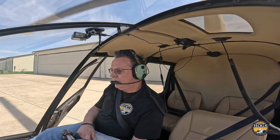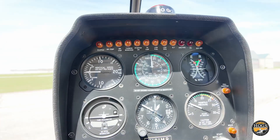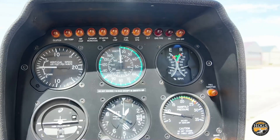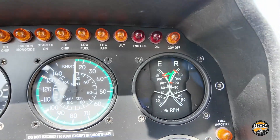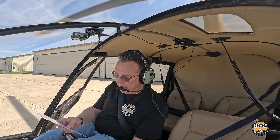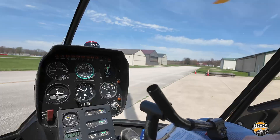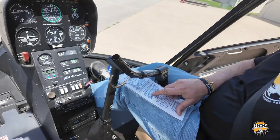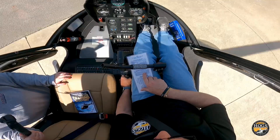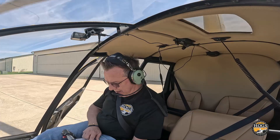Clutch check: roll up close to 80%, add a little right pedal, then throttle off — the needles just split, which is good. Pedals back to neutral, keep it around 70%. Doors closing and latched — doors are open for filming so I'll disregard that item. Manifold pressure limit check: at about 18°C and 2,000 feet pressure altitude, the limit works out to approximately 23 inches of manifold pressure.